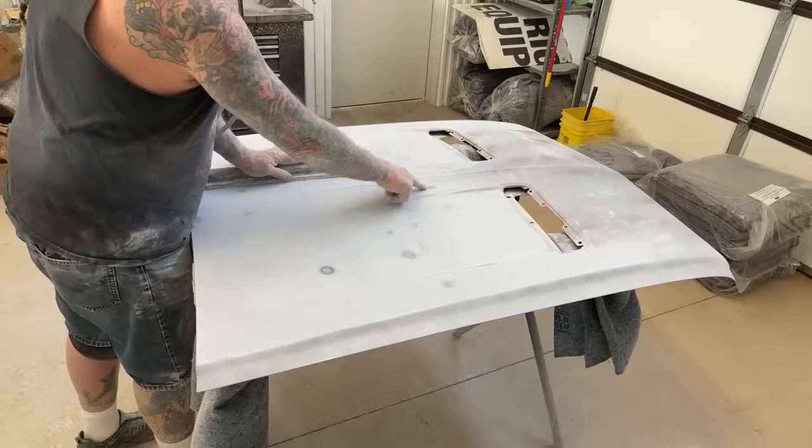This is Pete - my friend Pete, your friend Pete. This dent here is pretty much done. I can go over that with 80 grit, then 180 - that's a done deal. These are all done right here. I'm going to have to add some more here, and probably put some glazing putty to feather it out and fill it in. I still got several hours on this thing, and then we can go ahead and reprime - the fenders, the doors, and the deck lid behind that trunk lid. I've been working on these body parts now for almost a week and a half - very time-consuming job. But if you want the job done right, this is what you've got to do.